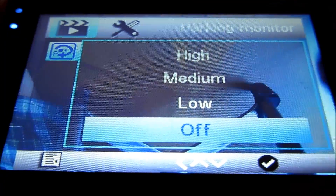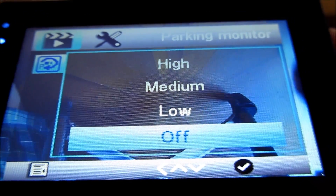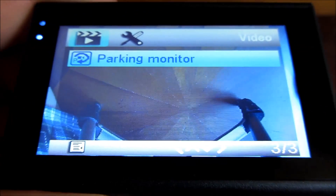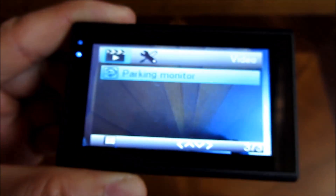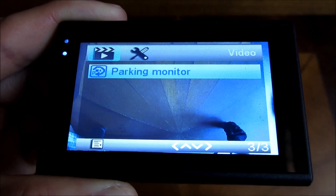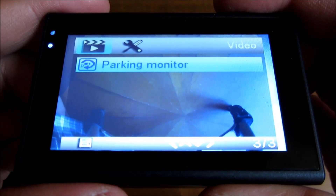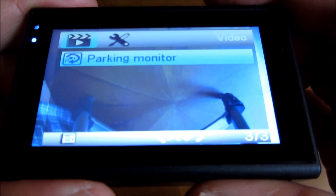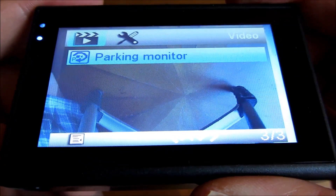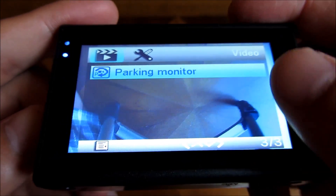Parking monitor is a feature I've seen in forums — not just on this model but on other dash cams — that causes corrupt files, so I have it turned off. I also have it off for another reason: the parking monitor triggers on vibrations. When I remove the camera and walk around with it, the vibrations cause it to turn on and off. This camera has about a 10-minute battery, so I don't want it turning on every time there's a vibration while I'm carrying it.